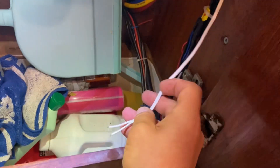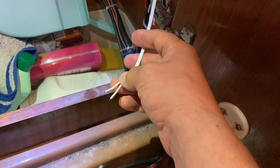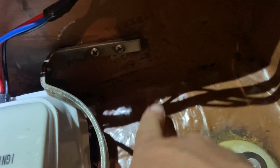As for the water sensor wires, they're just a bit short for this run, so I'm going to have to come back tomorrow and solder two extension wires on. I'll run them through this hole and out the other side, then tag them onto this bracket. I'll leave the wires about a centimetre off the very bottom of the bilge, so when water covers the two wires, they'll sound the alarm.